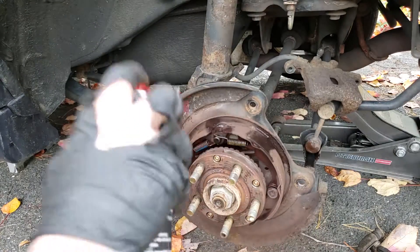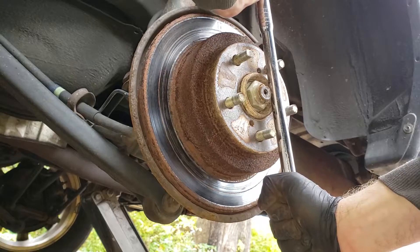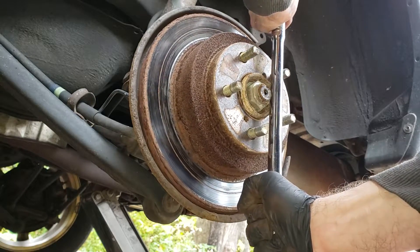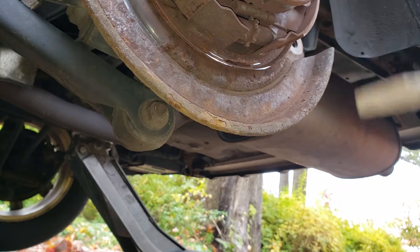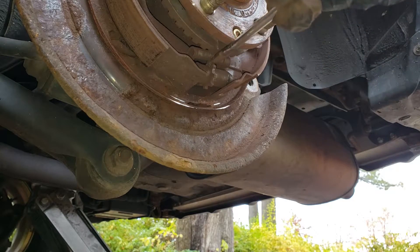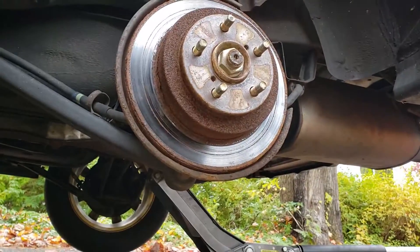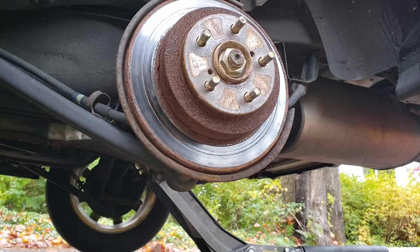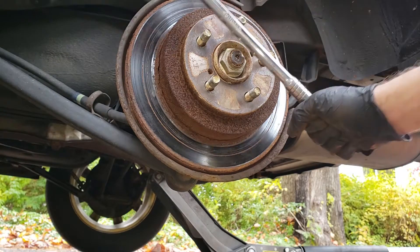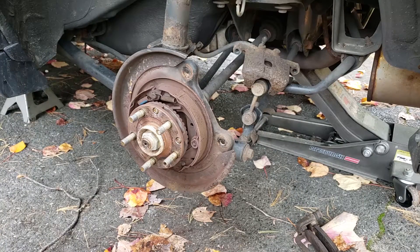What you can do is adjust them to go out farther. Now is also a great time to brake clean this stuff. I put the rotor back on. I can rotate the rotor no problem. Now I'm gonna put the handbrake up — it's clearly grinding, but I can still move it, and that's the biggest problem. Look at this little adjuster wheel right here. If we use a flathead screwdriver and pull it down, it should spread these pads apart. So let's test that theory — I'll put the rotor back on, handbrake back up. It just became a hell of a lot harder to move. You want to adjust it to the point where it is not rubbing while your handbrake is down, but if it's up, you want it to be pretty much fully immobilized. Once you're reasonably satisfied with your work, put that shit all back together in reverse.